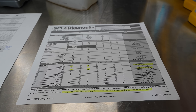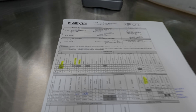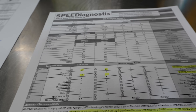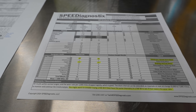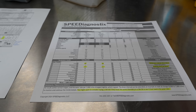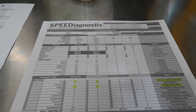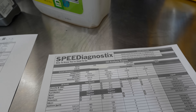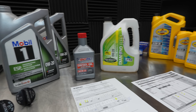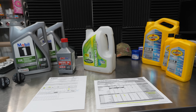Going back to the Schaeffer's: the Speed Diagnostics report shows copper at 12 and 11, which is a bit higher than my copper numbers across the board. I'm not sure if those are too high or just sitting at averages, but the copper numbers are a little concerning. The iron numbers feel a little higher than average but nothing to really worry about. I wanted to share those Schaeffer's results. Thanks to Carl for sharing them with me — hopefully you guys learned something from this. I'm not going to tell you what to run, but hopefully this video helps you make that decision.